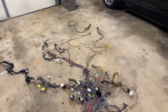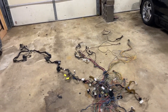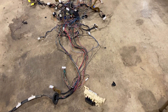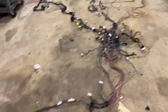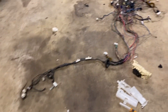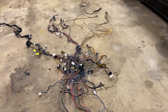I see why a lot of people do their own wire harnesses — it's actually a lot safer. You'd figure from the factory they wouldn't do stuff like that, but that kind of blew my mind. You'd be surprised what 12 volts can do. But it's not the voltage — it's the current that these wires carry that gets them hot. Too much current will make them overheat, and then they'll start melting stuff and you've got a fire.